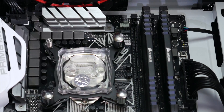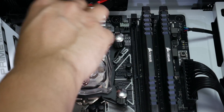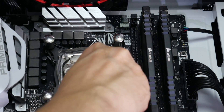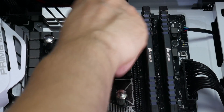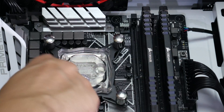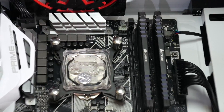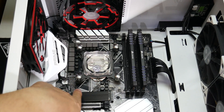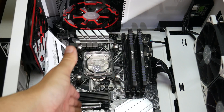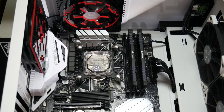I will apologise for some background noise — I'm waiting on a few important parcels so I've got the window open. Just go around and tighten up each screw one at a time, finger tight. Even with screw-type fittings you don't want to go too tight, especially fitting it outside the case because it will bend your motherboard. I'm also going to remove the M.2 drive for now because if there were any leaks, I don't want to lose it.